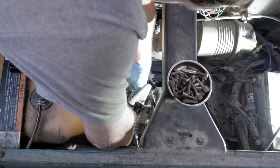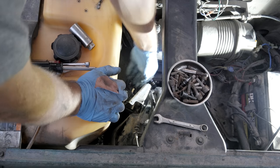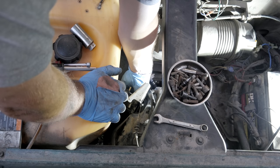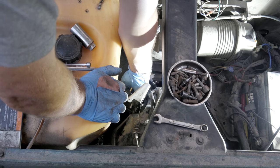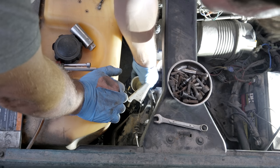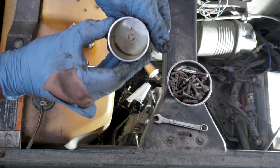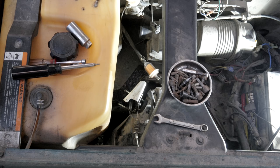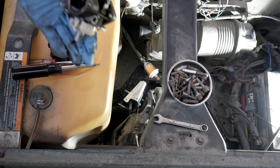This is going to be very difficult to get this carburetor out because the lift kit makes it difficult. This Club Car has this plastic everywhere in here. I'm going to unhook that hose and wrap it underneath the spark plug wire. I don't know if you can see that - see all that debris right in there? Yep, that's part of our problem. You guys want to keep putting lift kits on these things, it's going to make it harder for us mechanics to get these out. Let's go wash it in the parts washer.